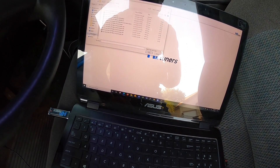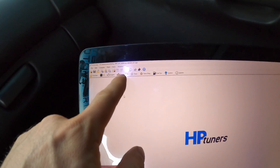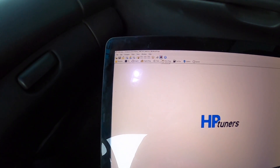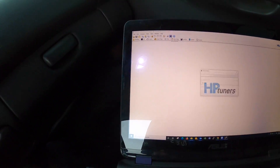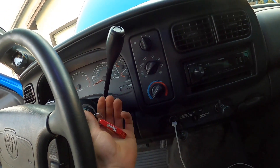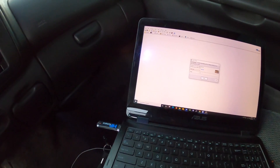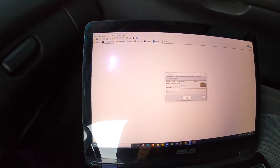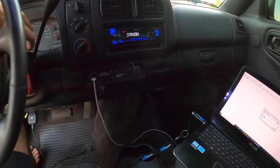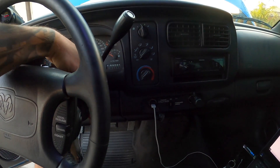You can verify which file you have open in the top left. Once that file is open, click the little chip icon with the red arrow that says 'Write Vehicle.' It's going to tell you the vehicle isn't on, so you'll have to turn your ignition to just before running - so all your dash lights show up. Then click 'Write.' It says 'Writing' - let it do its thing. You'll see a prompt saying turn ignition off, wait three seconds, turn it back on, then hit OK.